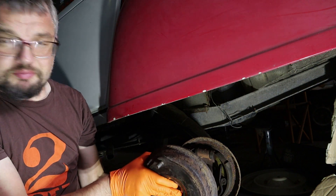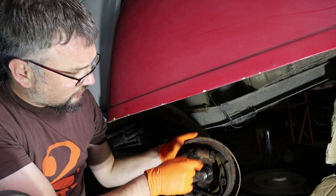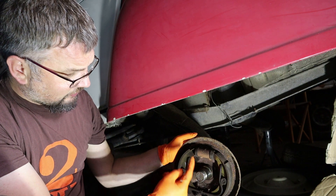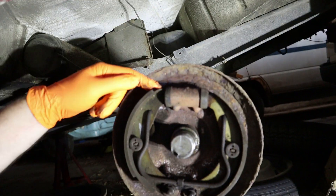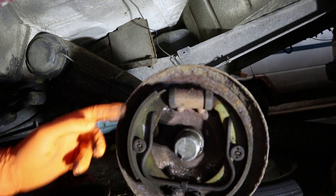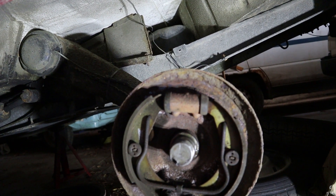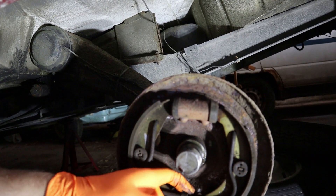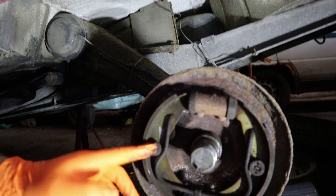So that's ready to go back onto the car, but before doing that I need to replace the wheel cylinder on both sides. This one's okay but I might as well do them both now I'm in here. It's been pointed out to me that the shoes are the wrong way around. It was Jono at Peak2CV who spotted this - apparently this gap in the lining should be at the top on the leading shoe, and I think the trailing one is also the wrong way around. So I'm going to swap those around too, which shouldn't be too difficult.